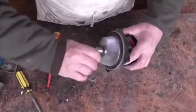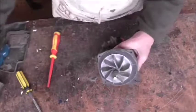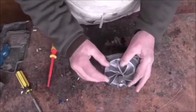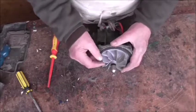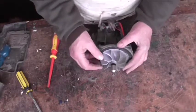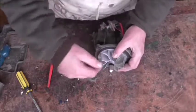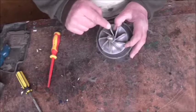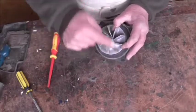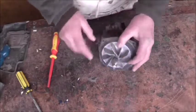There's the motor itself with a little fan. Make sure there's no damage on the fan - a little bit of wear doesn't matter, but if you've got one of these blades broken off it'll put the whole thing out of balance and be terribly noisy. If a piece is broken off and you haven't got a spare, what we used to do out in the field was break a piece off the other side, the corresponding opposite, and that would balance it out and it would still work.